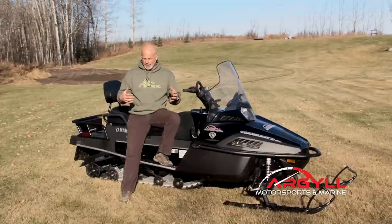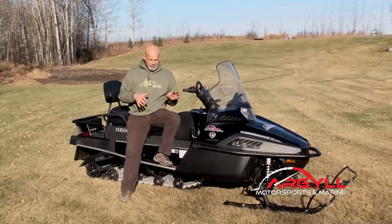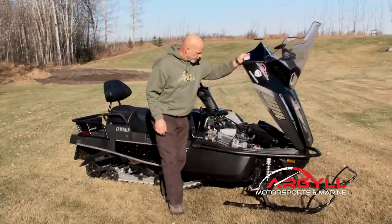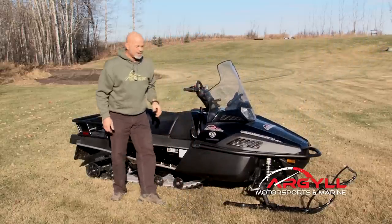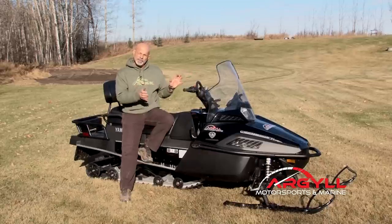For me, the most important thing is that the machine pulls — it's constantly hooked onto a sleigh and constantly pulling, so I needed that stability. I'm not going to say I'm a great snowmobile rider, and I need something that's predictable. Another thing that made this so cool is the electronic power steering. It's a unit down in the front, and it's progressive and adjustable. What I mean by progressive is that as RPM goes up, it supplies more assistance to the power steering. You can also adjust how much assistance it uses from the bottom on up.